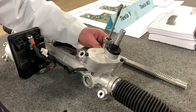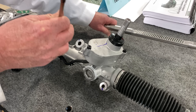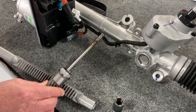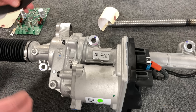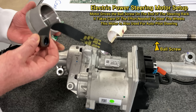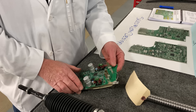Over here we have what you would see inside if you could take it apart. These are the components that basically connect to your steering wheel. This worm gear will fit kind of like that into the rack, and when you turn, this will move back and forth — that's how your steering system works. This is the belt that runs between the motor and the drive mechanism, and then these two gears will fit inside like this. As this one turns, this one will turn a lot more slowly.